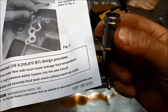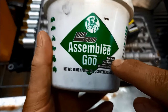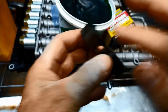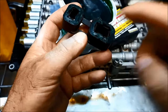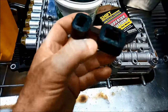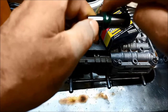To put the bridge seal in and hold it in there, as well as the valve, I'll use some of this high tack or firm tack lube guard assembly goo. As these warm up, that goo just completely dissolves in the transmission fluid, so it'll just hold it up there while I get the valve body up. You only want to use as much as you need - don't overdo it, because this stuff can also block one of the oil ports until the transmission warms up. This is the end that goes into the case; this side goes towards the valve body - you just want that to hold up there until you get the valve body on.